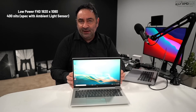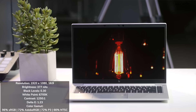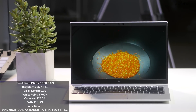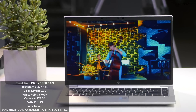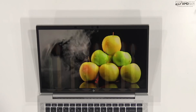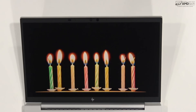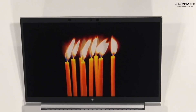One of the best parts of this laptop is its display. It's a 14-inch, 1920x1080 Full HD panel with a 16:9 aspect ratio — great for consuming media on Netflix, Amazon, and YouTube with no black bars. It's a very crisp, very bright display. This is the 400-nit low-power display and I measured 377 nits. Combined with the matte finish that eliminates glare and reflections, it's an excellent display.